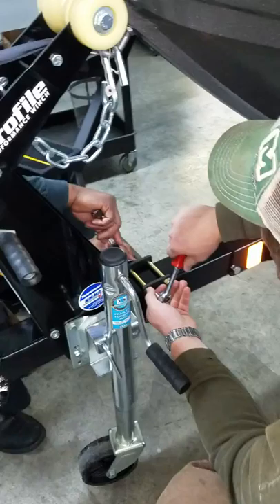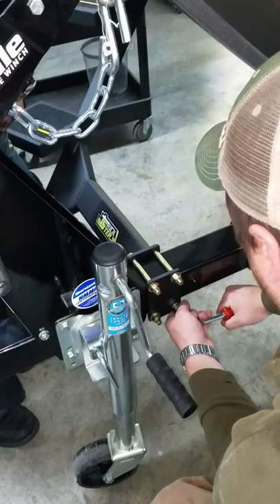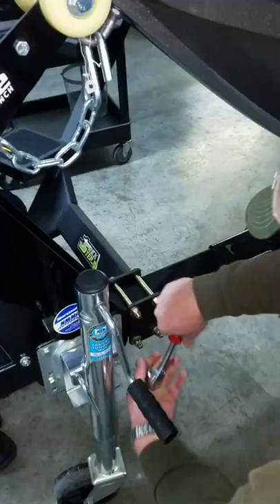Go around and check all four nuts again. Once you get them tight, we don't have a torque spec — it's just get it as tight as you can get it. Those are five-sixteenths plates that are there. You're not going to bend them in, but if it does bend them in, it'll just help wrap around the tube better. It's not going to hurt a thing. The step is installed.